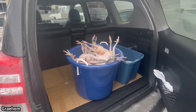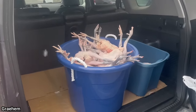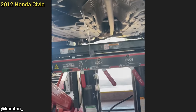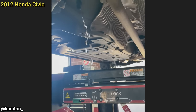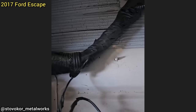This mechanic noticed an awful smell in the back of this customer's vehicle before bringing it into the shop. The customer stated water was leaking from inside the car. The technician found that somebody had put a socket in the AC evaporator drain hose.